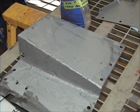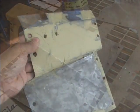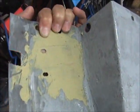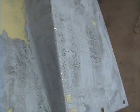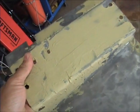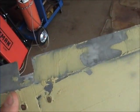I've just made a lot of work for myself sanding now. We'll see how it turns out. Well, I put the all metal on here, sanded that, threw a little bit more regular old Bondo on there, and I've been using a power tool, which helps out a lot. So I'm throwing a power tool on there just to knock down the big stuff, and then I hand sand it to get it smooth. So there you go.